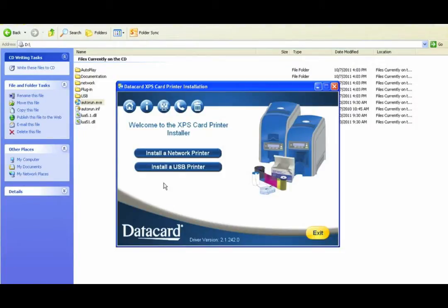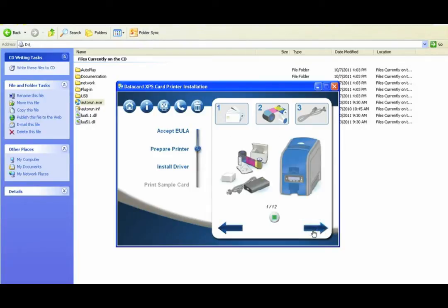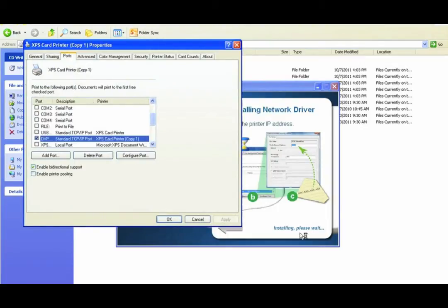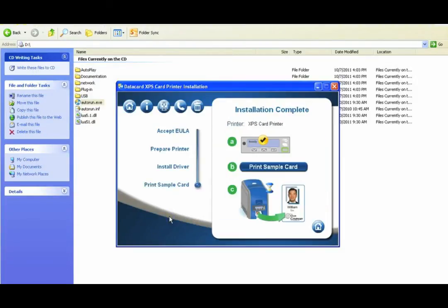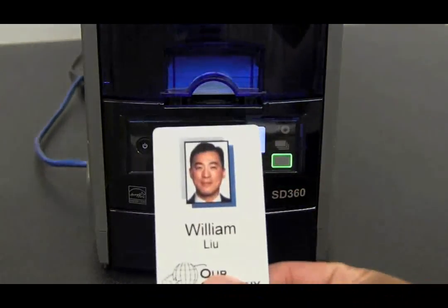After the printer is in the ready state, go to your PC and select Installing Network Printer. On the EULA screen, select Accept and select the right arrow. After ensuring the prep steps are completed, click Next and wait a few minutes as the network driver installs. Once you receive the Properties box of your printer, select the Configure Port button. Underneath the printer name or IP address, type in your IP address. Select OK and select Close. Once the driver has been completed, select Print to Sample Card. After your sample card has printed, you are now ready to use your printer.